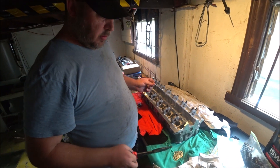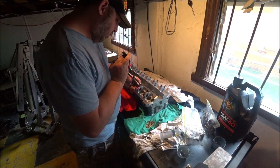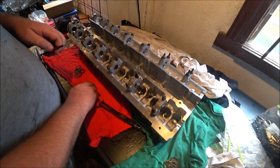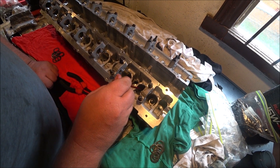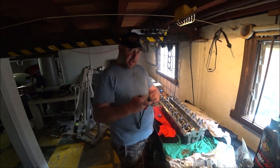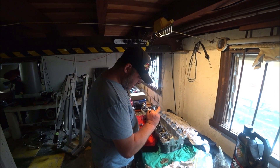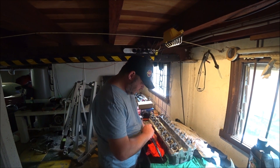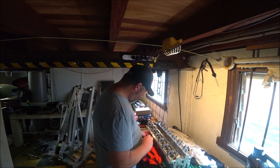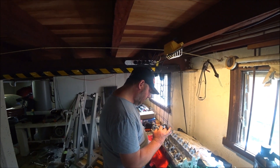All of them to do - these are all the exhaust ones and these are the intake ones here on the bench. On the exhaust side, just doing that to hold it and keep it straight in there. Drop it off - you can see it doesn't sit properly and then just give it a bit of a fiddle and in she goes. Rinse and repeat. Once these go in - springs, retainers, then the buckets, then the cams. I'll just keep tinkering away here this afternoon and I should have this head ready to go onto the engine very very soon.